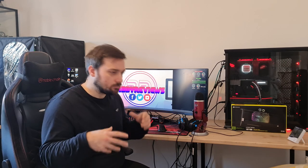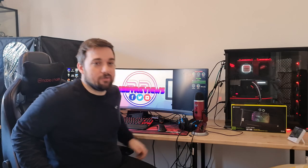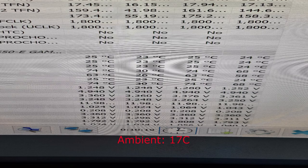Looking at the results, they performed really well and they look brilliant too — no hot spots on the RGB whatsoever. We ran Cinebench for 10 minutes for both fans, leaving the system idle for a few minutes first. Both ran at the same speed — around 1,800 RPM from the case hub, not the full 2,500 RPM — so a fair comparison. The Arctics came out at a high of 76°C and an average of 70°C across the 10-minute run. The Lightwings came out at an average of 68°C and a high of 74°C — roughly 2 degrees lower across the board.